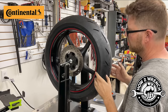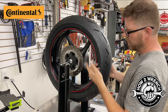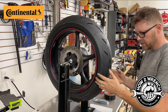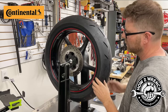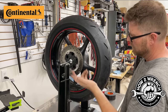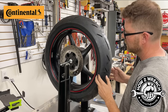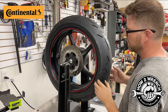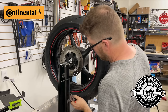Let's speed it up. And sometimes you gotta be careful. What was happening is it really wanted to go that way, but as I took my hands off, I don't know, could you see that? Where I actually started to pull it back and then I give myself a false indication of what direction to go. It's coming this way, let's help it. It's coming this way. Coming this way. Okay, now it wants to go back that way. So our heavy spot is right here, right?